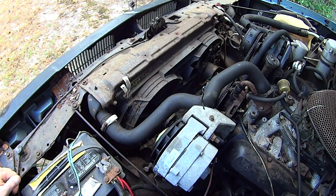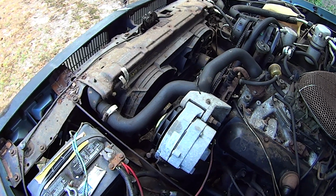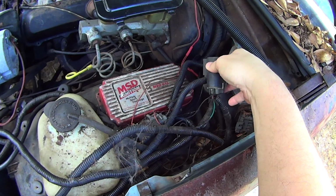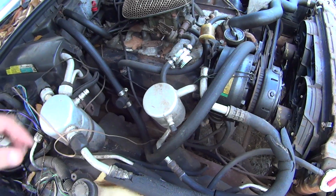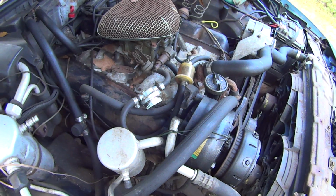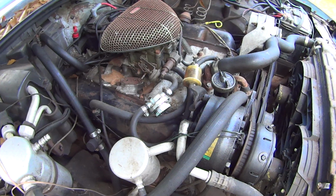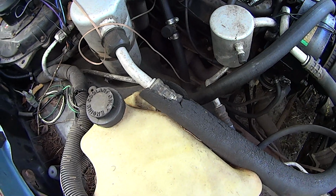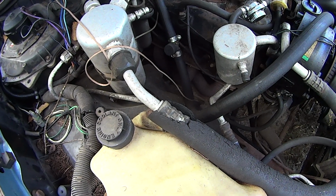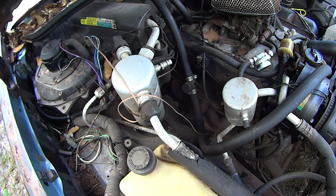The radiator fans came out of a Dodge Stratus found in the junkyard, but it fits pretty well and I never had a problem with it cooling. And I wired up the fan relays with some junkyard relays from an F-body Camaro. And it's got the old AutoZone fuel pressure regulator. And of course, a clear plastic fuel filter. Because you just got to be able to see the fuel that's going in. One of the only actually brand new parts on the car were the Dynamax long tube headers with 2.5 inch collectors. But we'll get into the monstrosity that is the exhaust system in a later video.